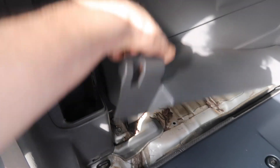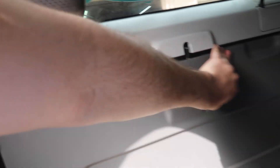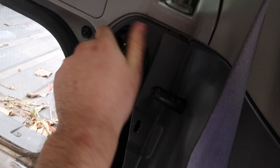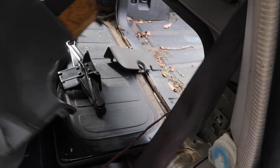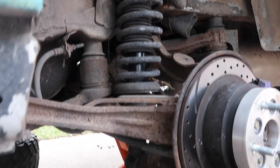Here I am taking out all the rear plastics. You've got this one plastic piece across, then you have to take the little doors off, open that thing up, and then it pops off. I've taken mine off before, which is why mine came off so easy. You've got the two 15 millimeter nuts for the top up there. That little door gives you access to your jack and spare tire changing supplies, but those two covers are what let you access the top of the strut bolts.